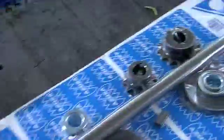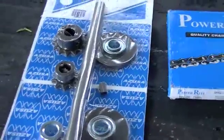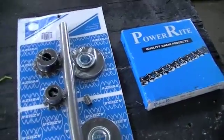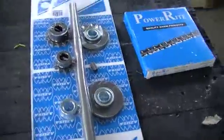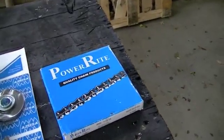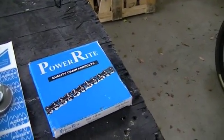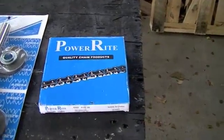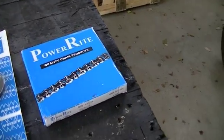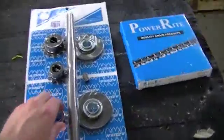I've got to do something about that, so I went up to Northern Tool and Equipment and got this jackshaft kit. We're going to put a jackshaft on this thing so I can center that engine in the frame. I also got a new chain — I needed that, my last one was too short. You should never add links to a chain; you can always take them out, but you should never add links back, especially on a press-fit chain.